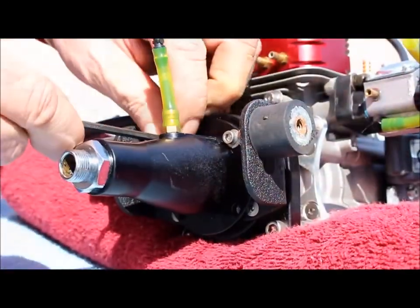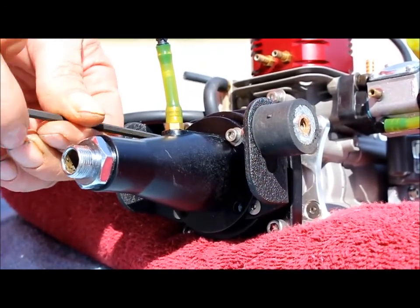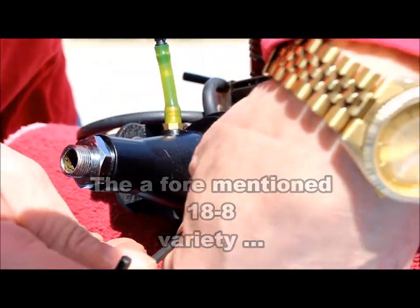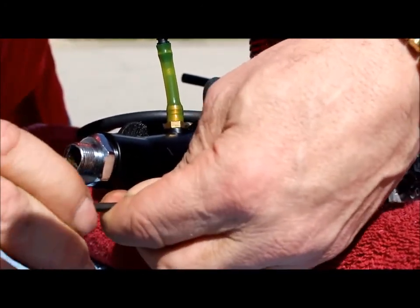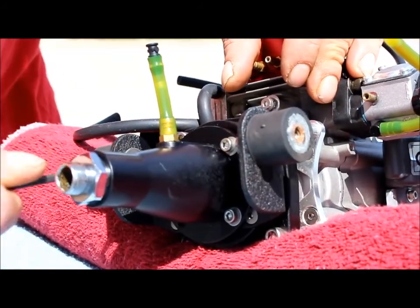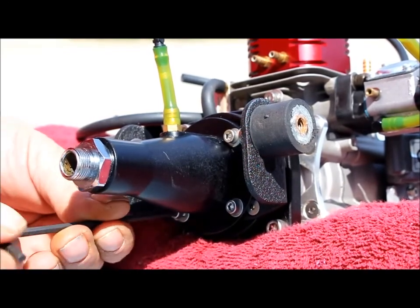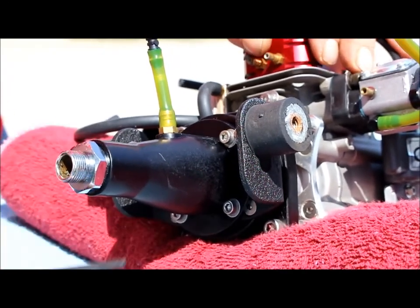The Enforcer housing is a glass infused nylon. And these are stainless steel bolts, so when you get them tight, just be careful not to over torque them. Just nice and snug is good, and they'll stick because of the way the steel sticks to the nylon. All right, so that's reinstalled.